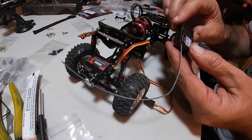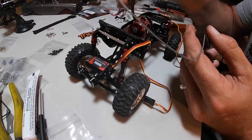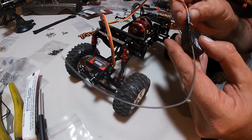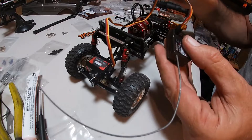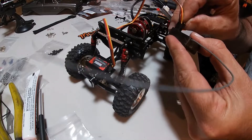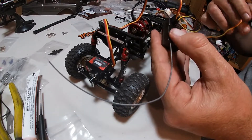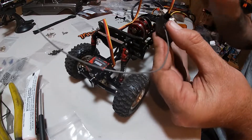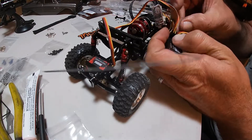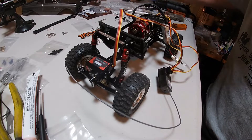I'm using a six-channel pistol grip radio because I want the third channel to steer the rear. So we got channel one to turn the front, channel two to the ESC, and I have the radio set so the rear steering is going to be hooked into channel three. I did hook this up to my phone app last night and programmed the ESC so I wouldn't have to do it today. And a new battery.